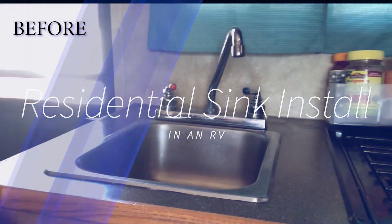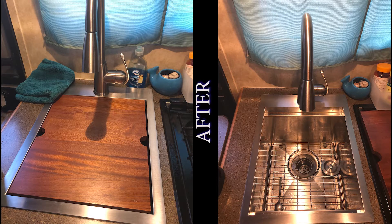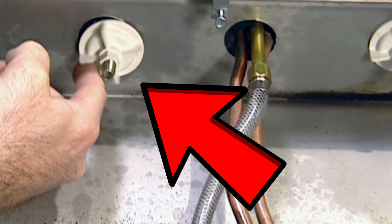This little curious cat is gonna get us both in trouble. Will you get out of there? Wish me luck. I taped bags over all of the electrical and back here too, because the pipes run over the electric lines that go into my control system, so you might want to take precaution to make sure none of that gets wet. I'm having trouble getting this nut off the last one, so I'm gonna pull the sink out first so I can access it a little easier with some tools. On my last RV, I actually had to drill the plastic part off — I could not get it off with my own hands or tools, but it was in a little more precarious spot. So if you absolutely need to, you can drill right through the plastic piece with an automatic drill.